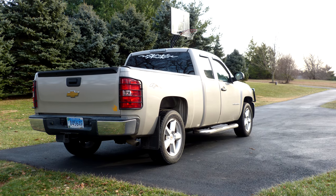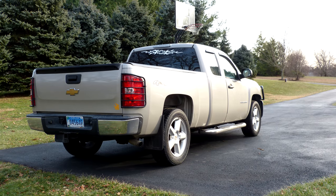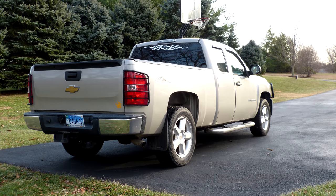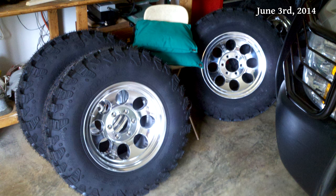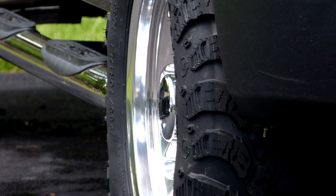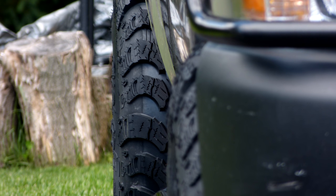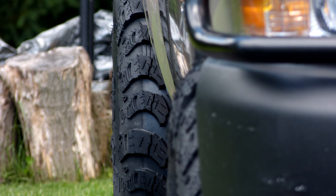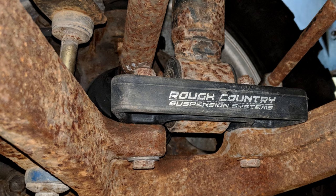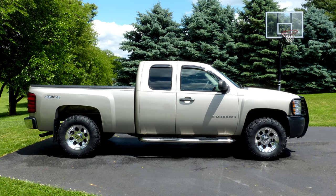I also didn't care for the stance of the vehicle — the rear end sits much higher than the front. A little bit of rake is desirable in a pickup truck with an empty bed, but I found it to be a little excessive. I did some research and came up with 17-inch Mickey Thompson Classic 3s and 285-70 Super Swampers as the best wheel and tire combination I could find for my price range. I went for an aggressive tire because I had big plans for what I wanted to do with this truck. To help fit these tires we installed a leveling kit to raise the front of the vehicle about an inch and a half, and I was finally happy with the look and stance of the vehicle.